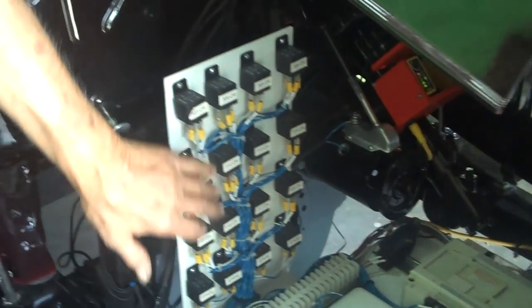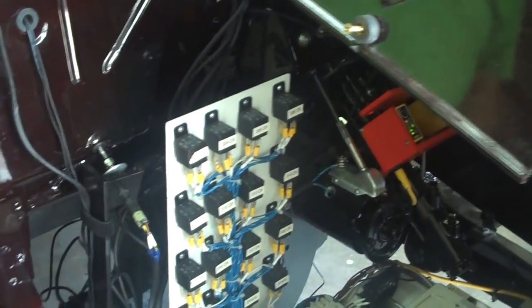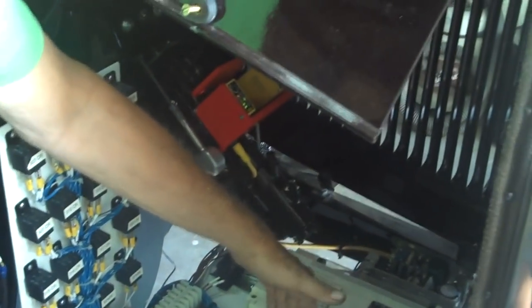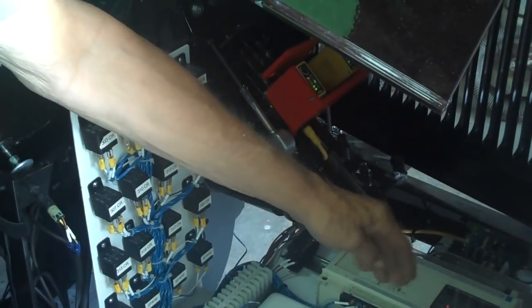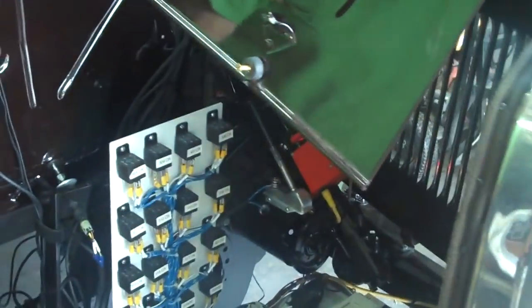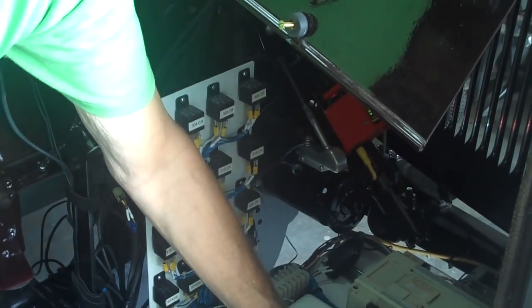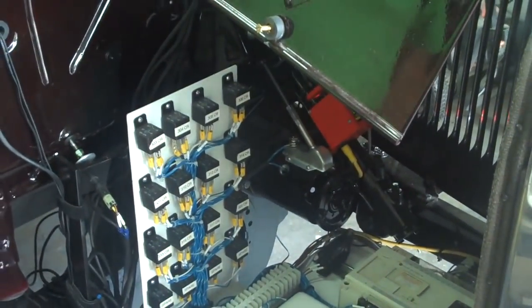And these are relays. These sound packages have each voice in them. Each sound has got one minute in duration. This unit takes signals from all my limit switches — like this limit here — it receives that, does that, and then also generates a signal to go out. I take this signal, put it in the right spot, turn the output on, which will turn the sound on for that function. I bought these off the internet. The inputs didn't work on one, but they work on this one. I've got the inputs here and the outputs here.